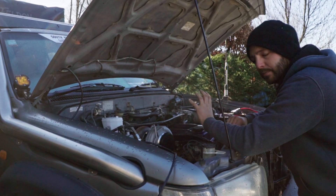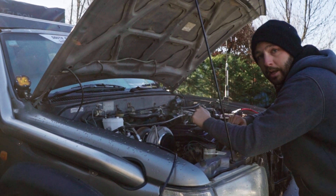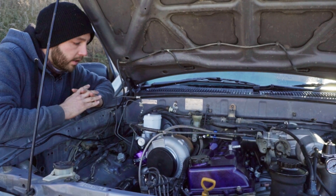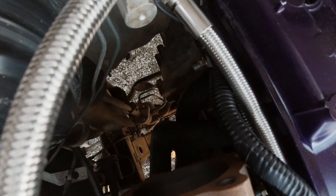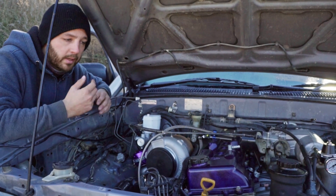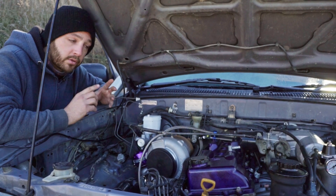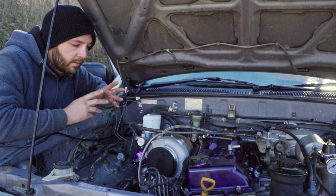The big one here is really just making sure we don't over-boost it via any sort of bad electrical work I've done — that's why that one's going in. The other one is going to be our air fuel ratio gauge, taken from the exhaust side of the housing further down the downpipe. This is going to give me a readout of my air to fuel ratio in the exhaust so I can tell whether I'm leaning out or running rich, and we can balance that. That is the really important one — we need to be able to tune this thing to run perfectly, so that one is really a must.